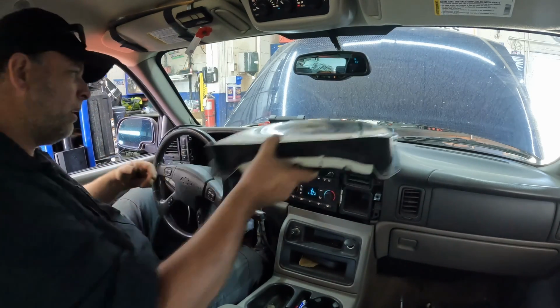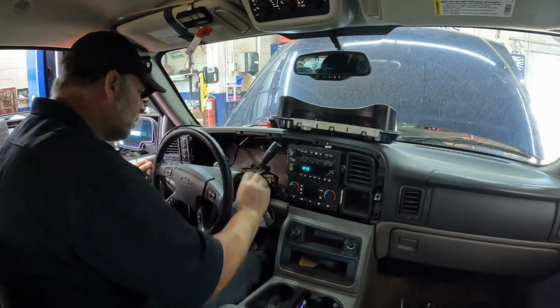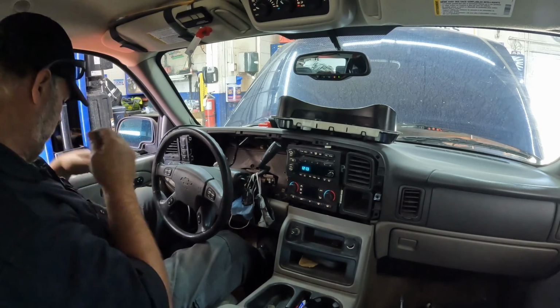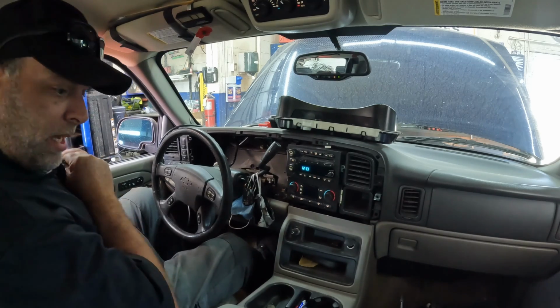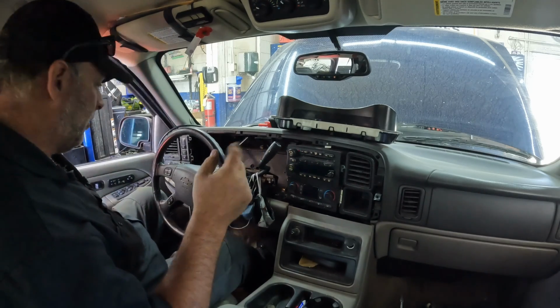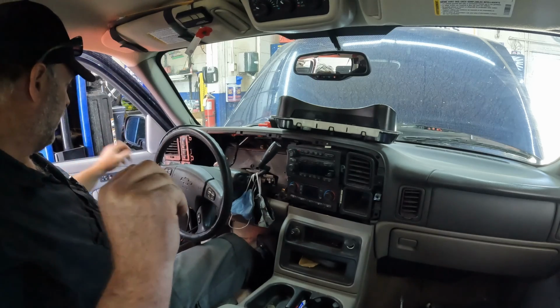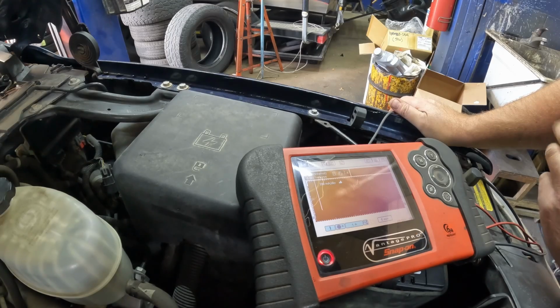Okay. I'm gonna go check it for a draw again and see where we're at as far as if our draw went away, or we're still there. Again, that doesn't necessarily mean we can condemn that instrument cluster, but it's just information for me to know. Wait and see what we got here.